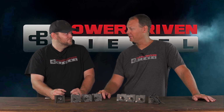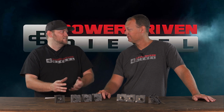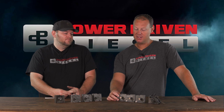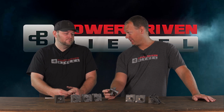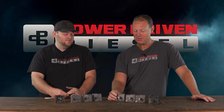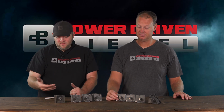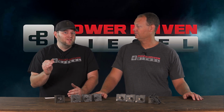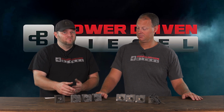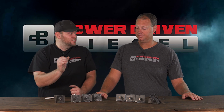What's an ARP 625 tensile strength? Is that 160? Well, you torque them to 160 to 180, but they claim the ultimate is up there like 280. Okay, so this is not as strong as an ARP 625 head stud material, but stronger than a factory head bolt material. Way stronger. So the things that hold your head on, this is stronger than that. The reason we went this hard is these factory ones barely register on the B scale for hardness. They're so low. So these are three and a half, depends on which one you test, four times stronger than the factory just from the material.